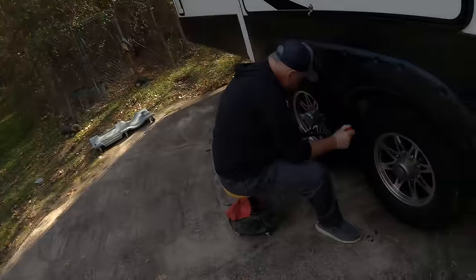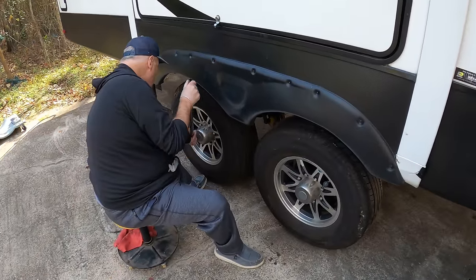We're done with this side — the tires are back on the ground and Mr. Thomas is torquing them. We're not going to go into how to torque them specifically for this rig — check the user manual on your rig — but we're doing a step technique in three stages getting to our final torque, and then after about 100 miles he's going to check the torque again.